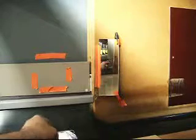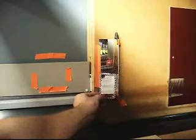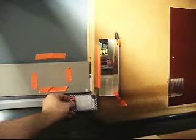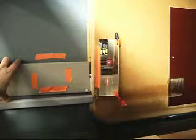Let's see. That's pretty good — it's got me at least past the edge of this wood with my beam. My bottom is clearly past the bottom of this reflector, and my top's going to be a little high because it's a big beam. But at least I've got the entire reflector inside the beam's actual target area. So now once I pull the cover off, you'll see the red light on the side of the screen just disappear because it should be centered up. And that's how you would zero in that photo cell on that reflector.